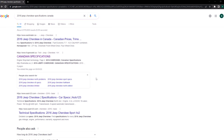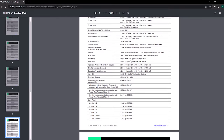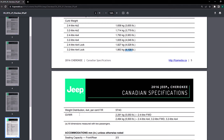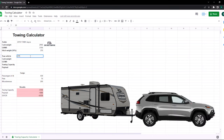Back in the computer — the first thing we want is the vehicle specifications for the 2016 Jeep Cherokee. Scrolling down to tow capacity: the 3.2 liter, when properly equipped with the trailer tow package — which this Jeep has — gives a tow capacity of 4,500 pounds. The curb weight from the guide is 4,108 pounds. I calculated the GCWR by taking the GVWR of 5,500 pounds plus the tow capacity of 4,500 pounds, equaling a GCWR of 10,000 pounds.